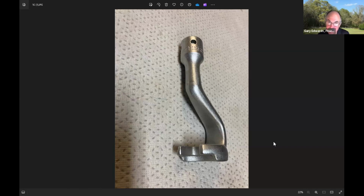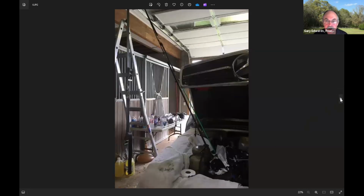And of course, doing a valve adjustment, you have to turn it over a lot, and changing the timing chain, you have to turn it over a lot. So it's useful to do that. I also found my cam oilers when I got in there were in good shape. I changed them anyway, but they were in good shape. So in this sequence, I'm doing the sprockets and the upper guides. And a very important piece here is that you should always keep some tension on the timing chain.